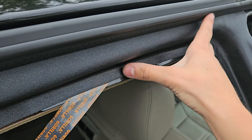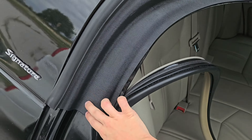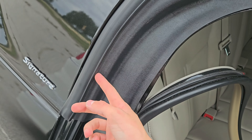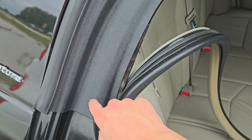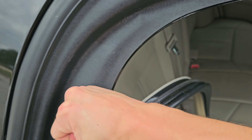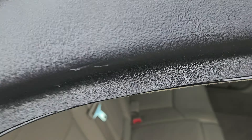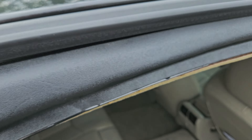Now that this is in, I can grab this and press it down in there. This side is now secure. You really want to take your time with this one. I had double-sided tape going up to here, took it off, lined it up, snug against here. Don't forget to tuck in the little plastic piece and then press it on. Make sure there's a little flap right here — push it up in there. It's pretty much almost dead on with this little raised lip.